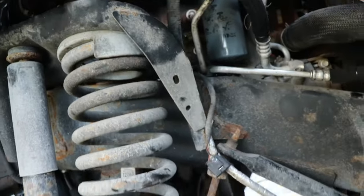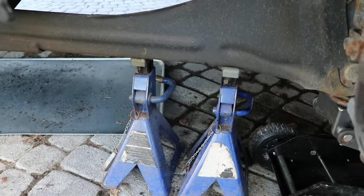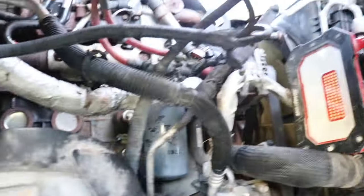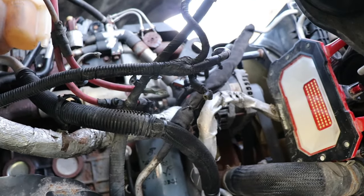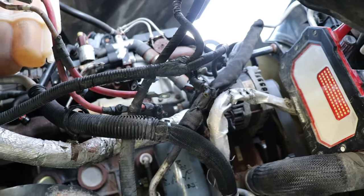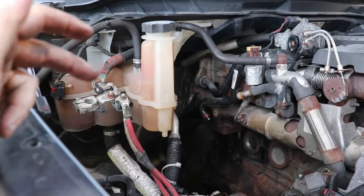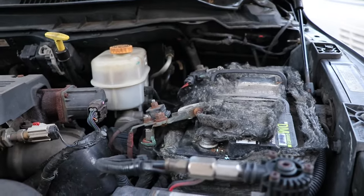To get this out, the truck is jacked up and I've got a couple of jack stands under this arm here — make sure it doesn't fall down. I've taken the battery box out and the battery, and I've got all the wiring kind of floating here. With these trucks as they age, it's good to take the battery cables apart and clean all the ends off anyway. It's like 8 millimeter nuts on this side to get the battery connections off, and then 10 millimeter on the other side — kind of strange, not the same from side to side.